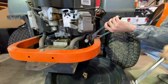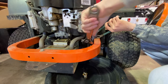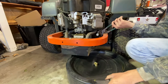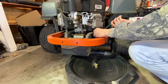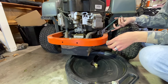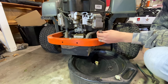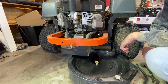Be mindful - if you ran this thing it might be hot. You can see I've got it pretty loose now, so I'm going to position the pan. Be careful, it's going to flow out as soon as you take this off, so be quick. That wasn't too bad - if you're doing a vehicle it'll come out a lot quicker than this. I'm going to set my channel locks aside and let this thing drain for a bit. I'll come back whenever it's done.